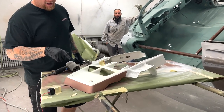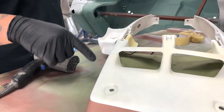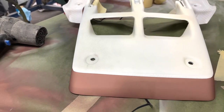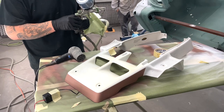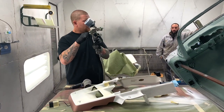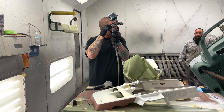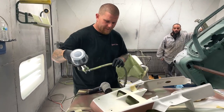Come in and look — you see one little tiny pass and look how splotchy it looks. That's what you do not want. So we want to choke the gun even more — I'm going to choke it all the way till we have barely any paint coming out of the gun.